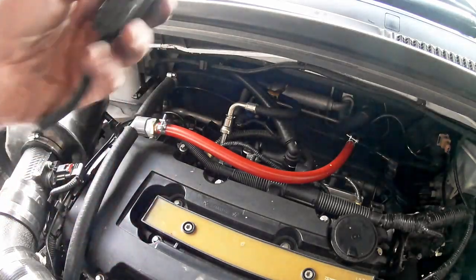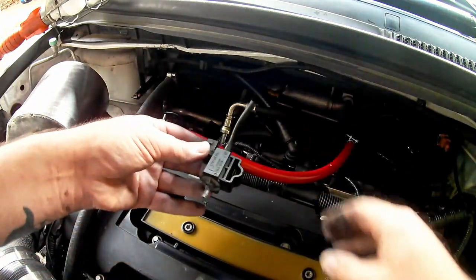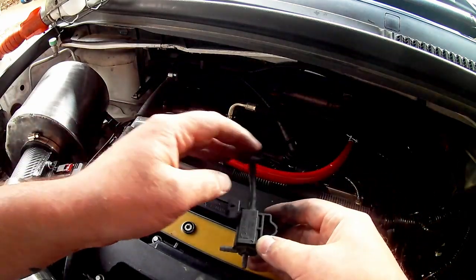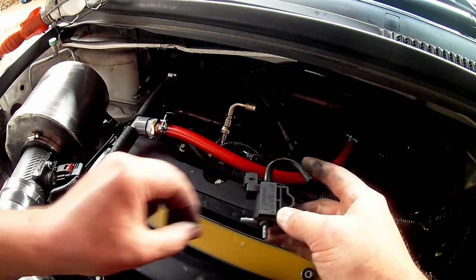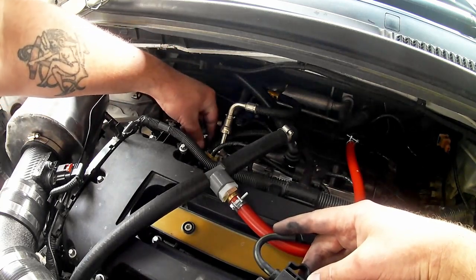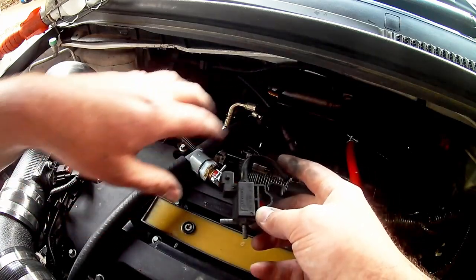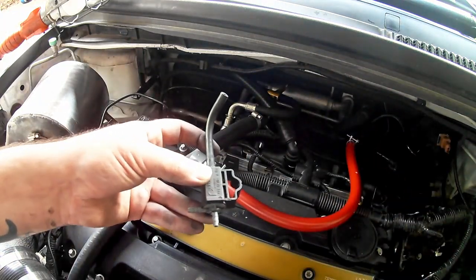You obviously could not see hardly any of what I just did, so I'm going to make it really easy. Underneath the manifold, that is clipped in there just like this — this line runs up into the manifold. What you're going to do is unplug this line, get that out of the way. Then this side here is what runs to the bypass valve — pull that off. That is this little rubber elbow thing. Then you're going to run another line like this to the intake manifold part. That part is done. Now you're going to plug off this side and this side — that's where the caps come into play.